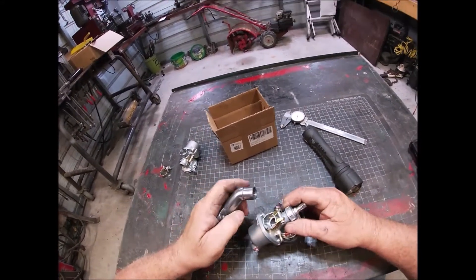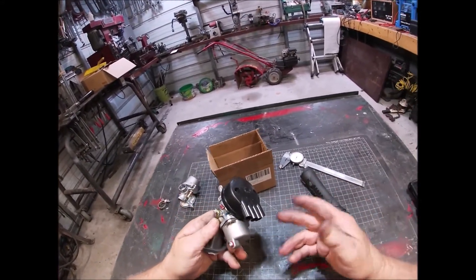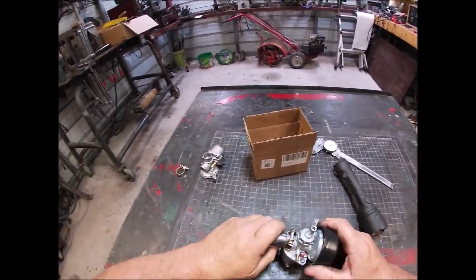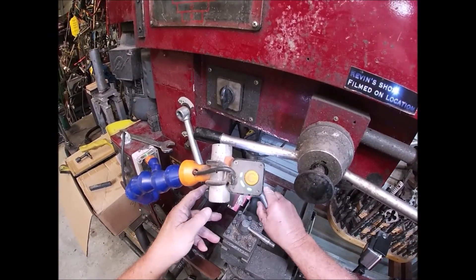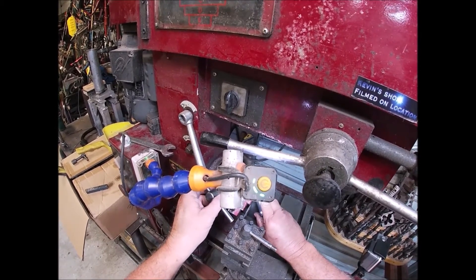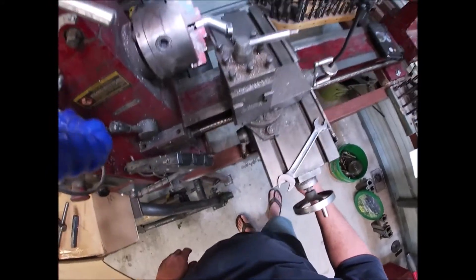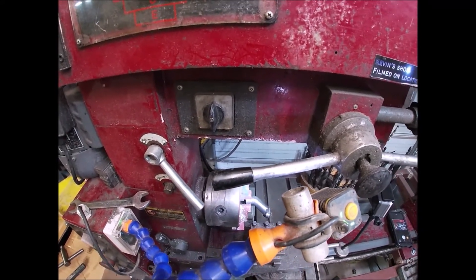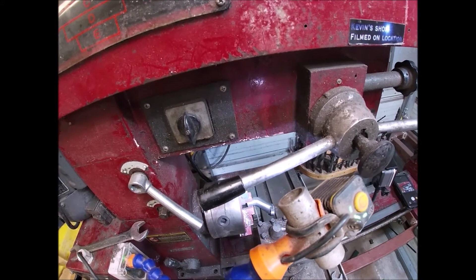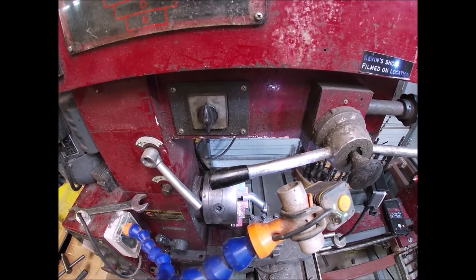The man bought a bicycle — he should be able to take the carburetor on and off without having to throw half a tube of goop on it to get it to work. I've got a plain part-off tool in here and I'll cut it down. I don't want to clamp it too tight, but I don't want it loose either. Like I said, you could do this with a Dremel, or if you know somebody that's got a lathe. We don't need to go that much — just about twenty-five thousandths.